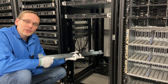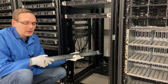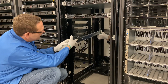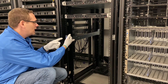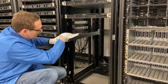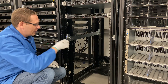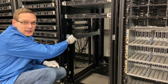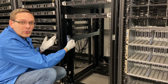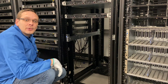So now we're going to put our server into the rack. First things first, you're going to want to grab both your rails. This one is left, so just make sure the left is facing up and you're on the left side. I like to do this with two people — it just makes it a little bit easier. So one of our techs, Angel, is in the back and is going to help us. We're going to do 14 and 15. There are two pegs right here that I'm just going to line up to the rack, perfectly lined with 14 and 15 so everything is equal all the way across, and we're just going to simply push them in. When I push them in, this little blue clip kind of opens a little bit — enough that the hooks inside have now latched on and you can see that this is firmly into place. If you wanted to remove this, you would pull this blue clip out and the rails will come off the rack. So now I'm going to put them back in — just put the two pegs in, push it in and it's now firmly locked into place.